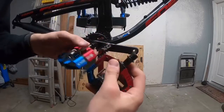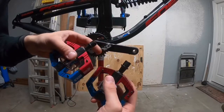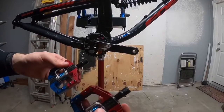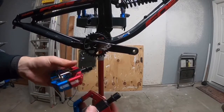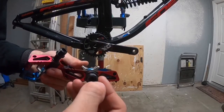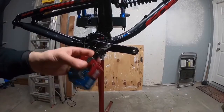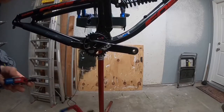This is the thread pitch going up, this is the thread pitch going down. Most of the time they have indicators — this one actually has a little 'R' on it, so this is the right pedal. This is the left pedal. Don't just try threading them in to figure it out — you're going to over-strip the pedal. Good thing they didn't send me two rights or two lefts; I've had that happen before with a different company.